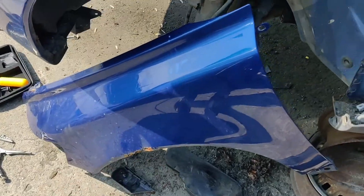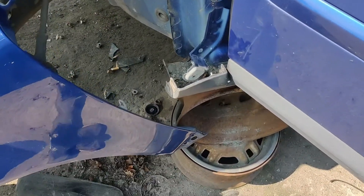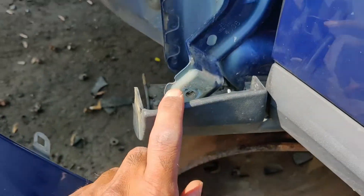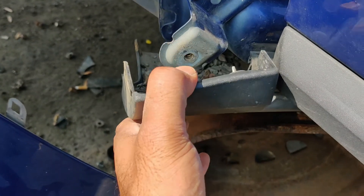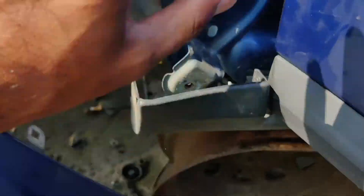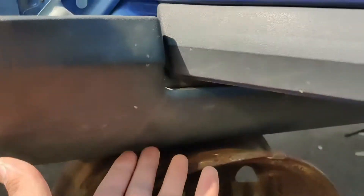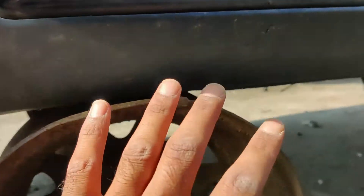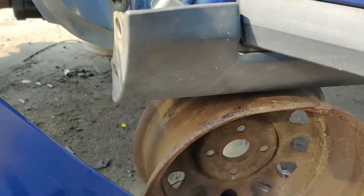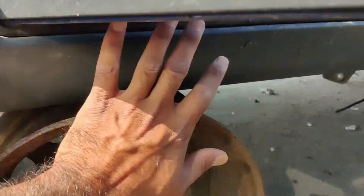So that's how you remove the front fender. The tricky one I almost forgot about — this plastic panel — is really the tricky part. When you pull it out, don't break this one and don't break the other one. When all the screws are removed, gently pull. The right way is to go under and remove the screws along the bottom so that this panel is loose and just hangs — then it's easy. I recommend that way; I was at the scrapyard so I did it differently, but I don't recommend that approach.